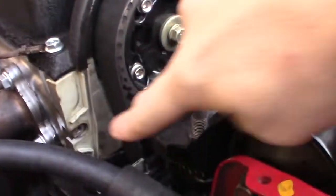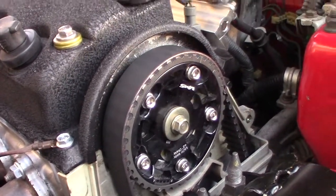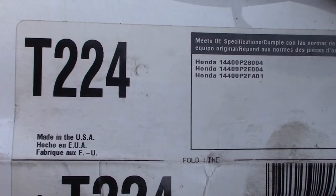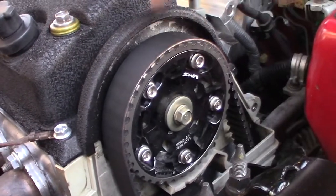When you put the mini-me together, you're going to use the timing belt kit for the block. This is a B7 block, so I'm using a B7 water pump, B7 tensioner pulley, and spring. For the timing belt: since the Z6 head deck height is slightly shorter than the B7, I used a Gates timing belt, part number T224. This belt has 104 teeth instead of the 106 teeth that the stock B7 timing belt has. Use the 104-tooth timing belt — it's slightly shorter to account for the lower engine deck height.